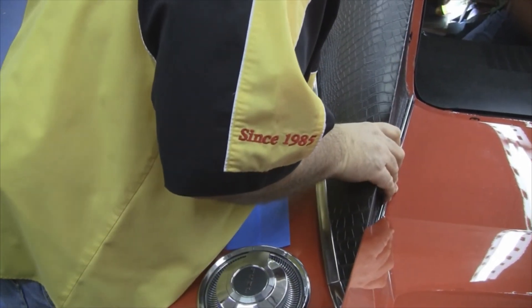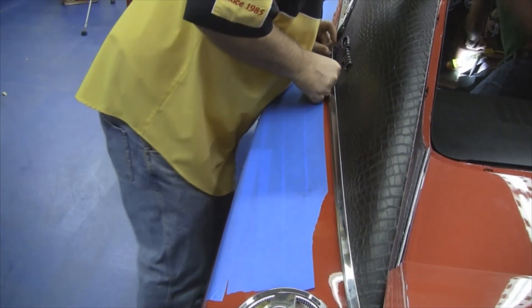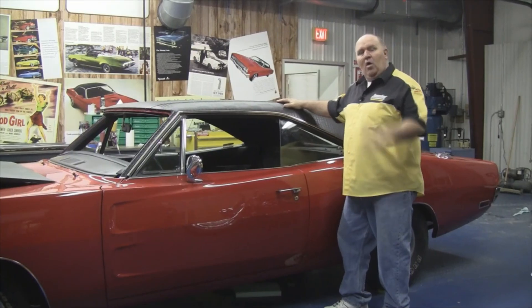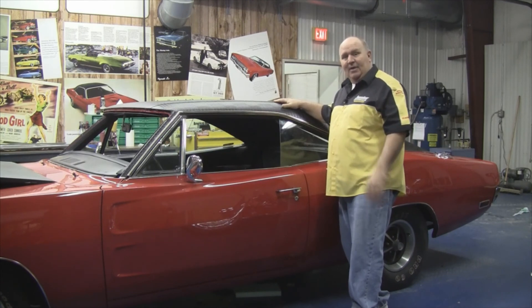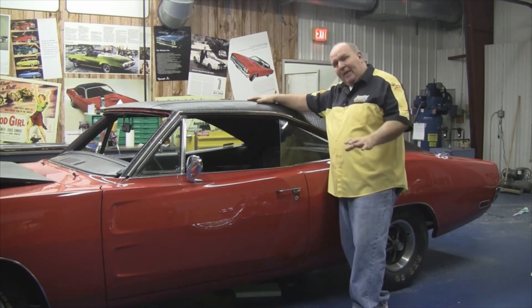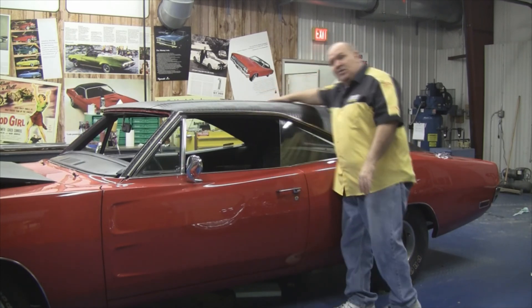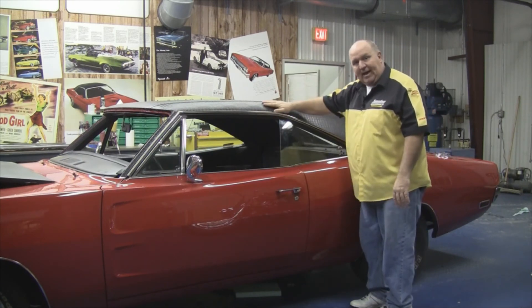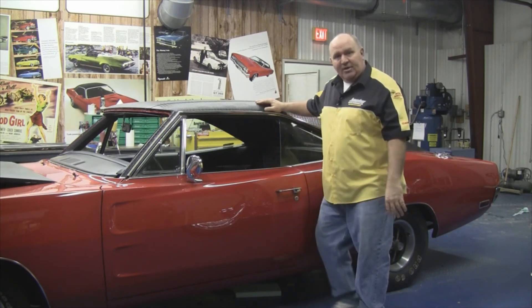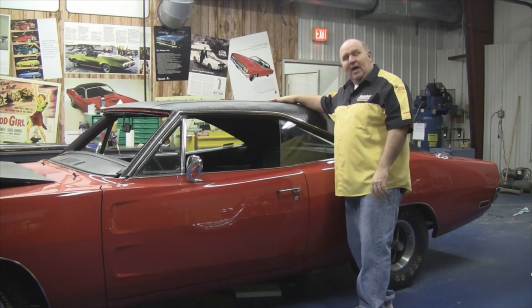You want to dry fit everything before you actually snap it into place, because when you snap it into place you want that to be your final installation. Hopefully this video has been very helpful for you — you can see how easy or hard it is to do a vinyl top. Keep in mind, if you're doing a vinyl top on any other model car that has a rear valence below the rear window, you want to do that center deck first, then come back and do that panel below the rear window, and then do the outsides of the car very last. I'd like to thank all the people at Legendary Auto Interiors for making this possible, all of our sponsors, and most of all thank you. I'm Ron Halbrenner for Legendary Auto Interiors — we'll catch you next time.